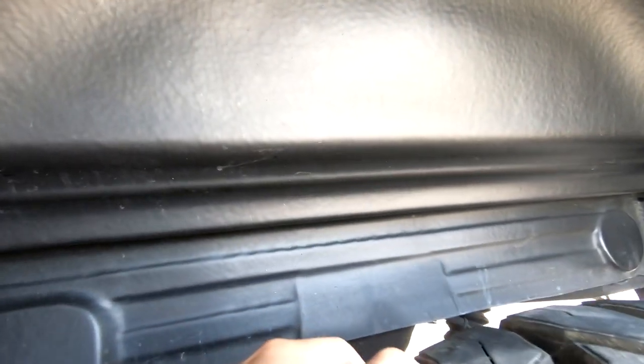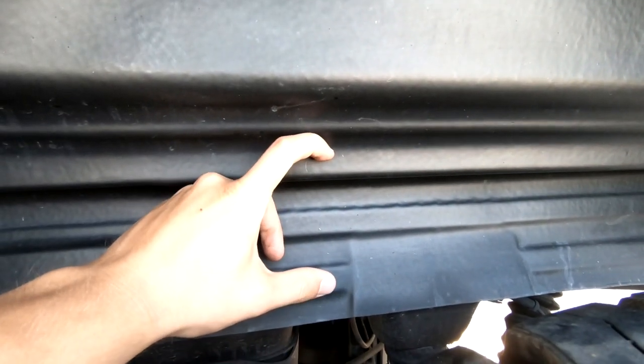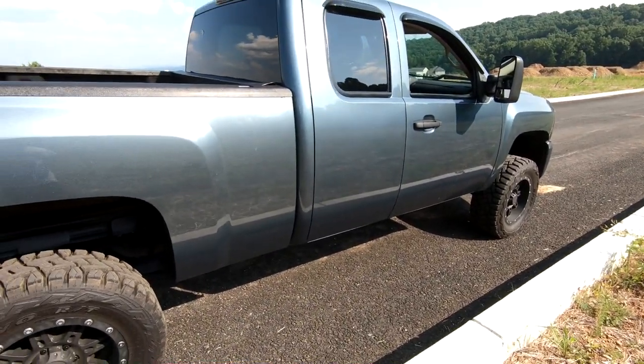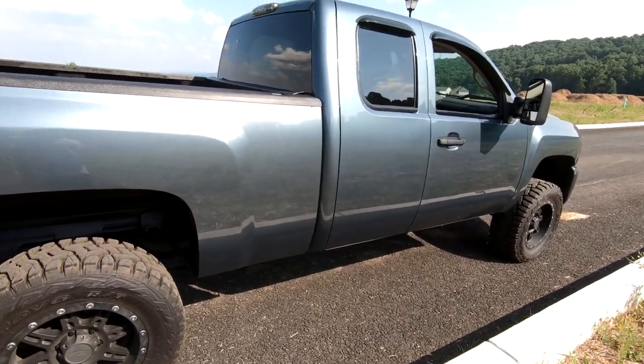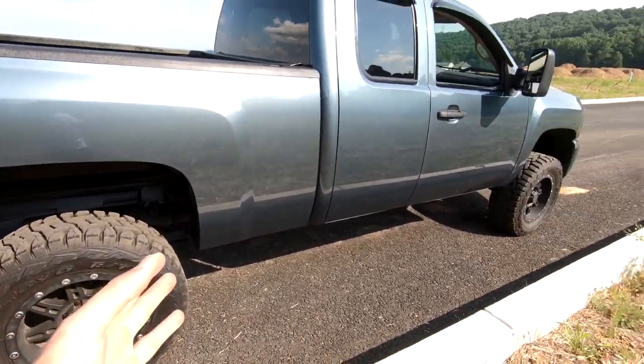The worst part about it is the rear of the truck. I have these Rough Country well liners now, but before there would be a 1.5 inch gap of light between my frame and my body, and that looked absolutely hideous - everybody would notice and say something about it. The main goal for buying a body lift is to fit bigger tires. As you can see, I can now fit these 33x12.5s, and if I turn the wheel all the way it's only about an eighth of an inch of space before hitting the well.